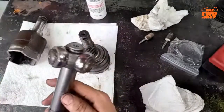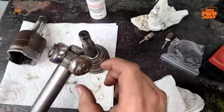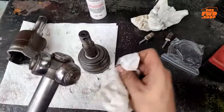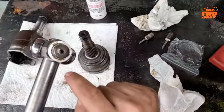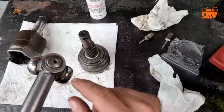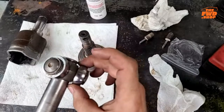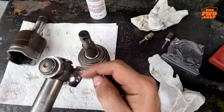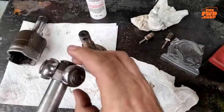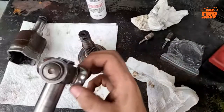Now this end, I usually go through and I will brake clean out and clean all those bearings, because you can just kind of grab them, clean them, go through, right? The trick, though, is you want to make sure you get that grease back in there. If you pull that grease out, you need to make sure grease goes back in because, again, it's not oil. If you only have grease on the top and you only have grease on the bottom, that means half of those roller bearings in the middle is not getting any sort of grease in them. So you want to get a needle or something to make sure you get it down inside of there, rotate it around, play with it. That takes time to make sure that these are greased up properly.